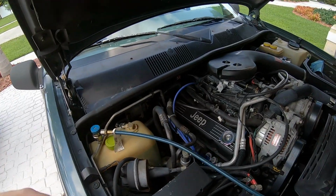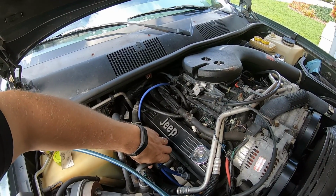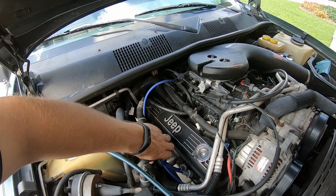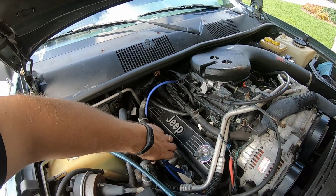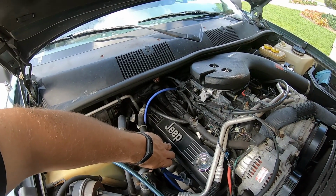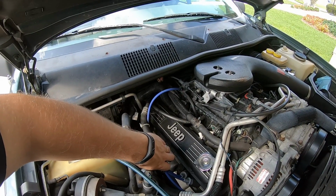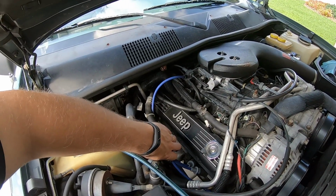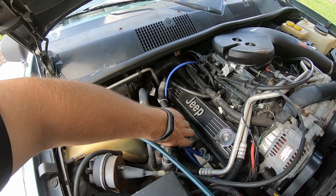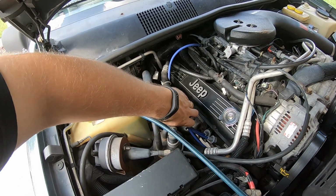Oh, and I should say what it means when it's at that temperature. Let's put it this way, the evaporator has removed the heat from the air in the vehicle, and there should be some residual coolness, if you will, coming out of the evaporator. If it's warm, that means that the evaporator is not saturated. Again, this is kind of a shade tree trick. Normally I would charge it with subcooling and superheat, but I can't get a high side gauge or high side pressure on there.